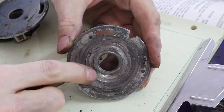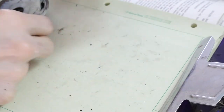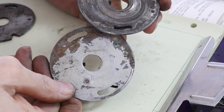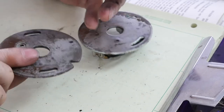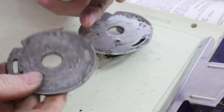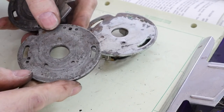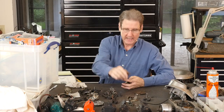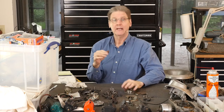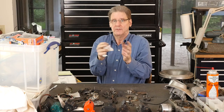Notice how this plate is all chewed up — it's got these big grooves, you can feel them. Notice this plate is pristine. Notice this plate, which is the right side, has divots in here. This is the top, this is the bottom, because of these little bumps for the condenser. What does that? I think how you ride — like I do a lot of around town, so I'm always going off the advance and on the advance. Those weights are working a lot.